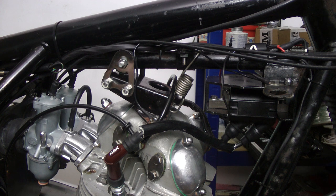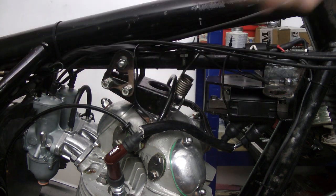That's fine. When you switch to ignition only, that's position 3, that will power up the ignition on the bike and such things as the horn supply and the brake light supply, and potentially the hazard flashers if you've got that fitted. And then obviously the 4th position then turns on all of the lights as well. So in position 3, where you've got the ignition on only, that is actually putting power on to, according to the Lucas wiring colour scheme, the white wire.